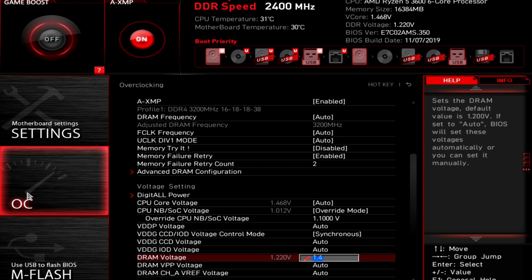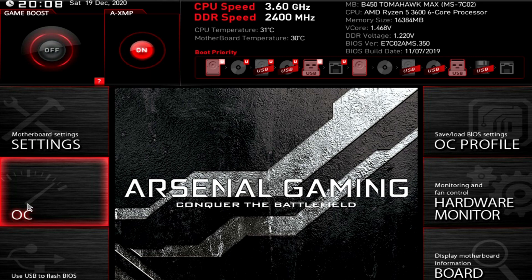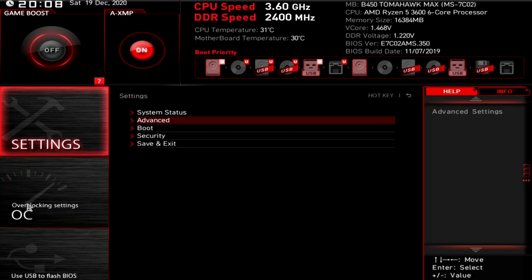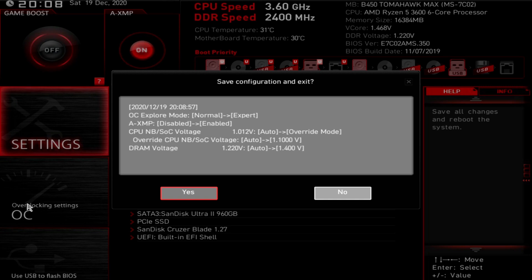After you do that, go ahead and find your DRAM voltage and change it to 1.4 volts. I personally do not like to go over 1.4 volts. With a little more experience, 1.45 volts for DDR4 kits is pretty safe generally, but I definitely wouldn't recommend going over 1.45 at all. After you set these voltages, save your settings and hit restart, then jump back into your BIOS by hitting the delete key while it's booting. Once back in your BIOS, head back to your OC tab.